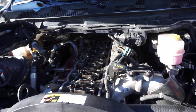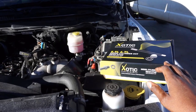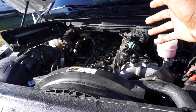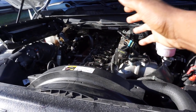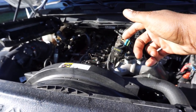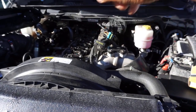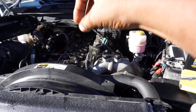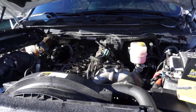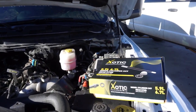We're going to take off the rocker box, remove all the valve train, and then start taking out studs one at a time. I already have an installation video on how to install studs on a 6.7/5.9 Cummins. Long story short, it's a one-for-one bolt swap. You take one head bolt out starting in the middle, swap it with a stud, torque it down to the specs in the installation instructions, and work your way out. Once you're done, do a final torque check.